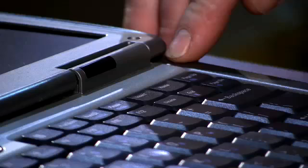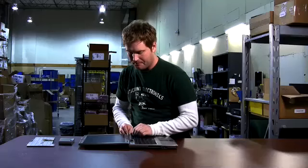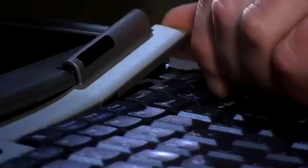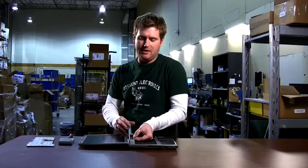The next thing you want to do is open up the laptop lid as wide as it'll go. If you notice on the top right hand side, there's a groove. This is where you'll need a small flat head screwdriver — you basically put it in that groove and just pop up the end. Without putting too much pressure on it, just work your way down the power bar strip, hitting every snap point, and it just comes right off.